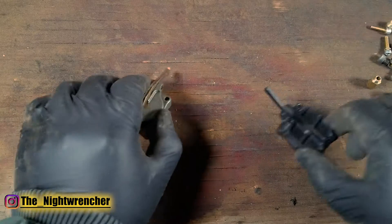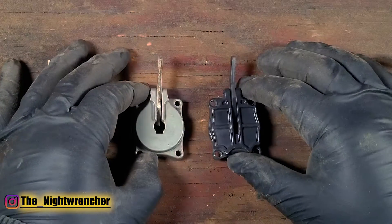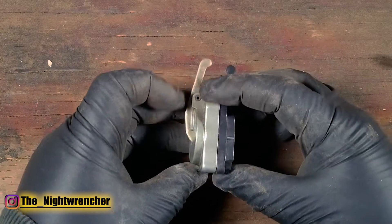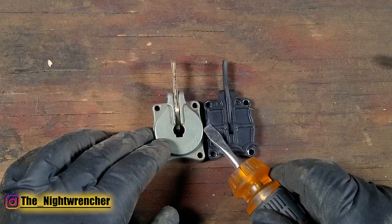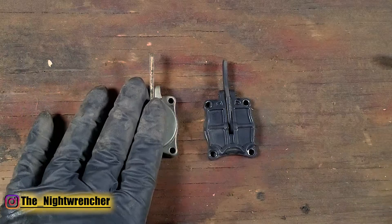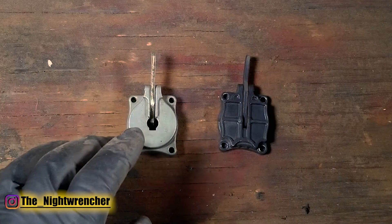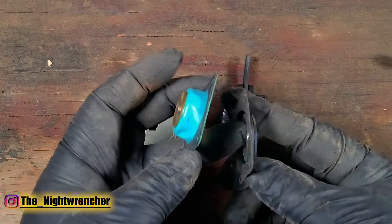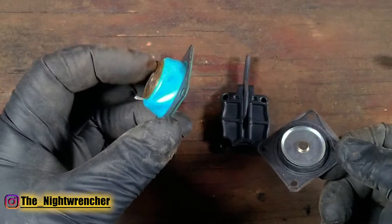On the secondary side there's a 50cc accelerator pump. From the top, the left and right accelerator pump diaphragm covers look exactly the same, but a side-by-side comparison shows one is taller than the other. This one is the 50cc accelerator pump and the other is the 30cc accelerator pump. The diaphragms themselves that drop inside are different as well — the 50cc diaphragm is significantly taller. This one has a bit of wear and has compressed down, so we're going to replace it.